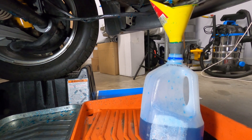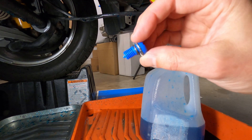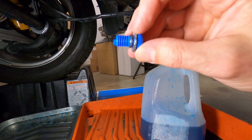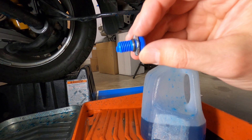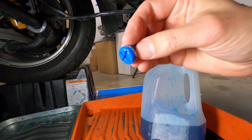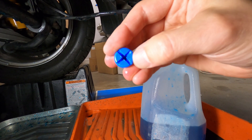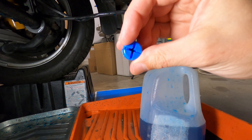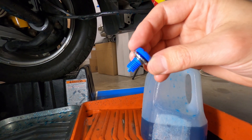But if it's generally clean, you can go ahead and return the drain plug and perform other work on the car until it's time to refill the system. You'll notice on these drain plugs that the O-ring is actually on the shaft of the screw, so there's no need to over-tighten these. If you do, you'll end up snapping the head off the bolt — it's just a plastic bolt. Not to fear if that does happen, because the tool markings go into the shaft so you can still pull it out with a screwdriver, but you'll need to replace the drain plug and they run about $10 a piece.